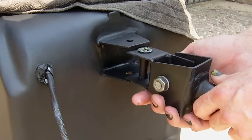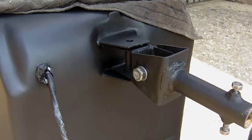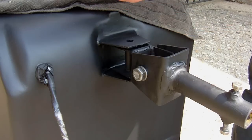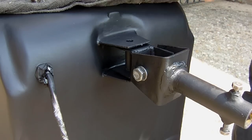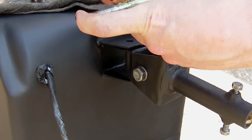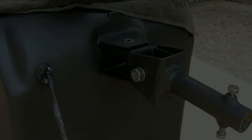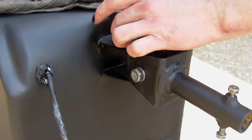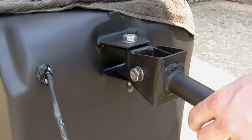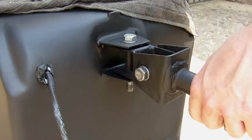Now here we go, I'm going to proffer that up — here we go, it slides in — and then we'll pop the bolt through. Now this one's a longer bolt that I've used, so this one's a lot longer, so what I'll do is I'll put a lock nut and some Loctite on it, and that should do it. So we'll grease up the shaft — we want plenty of grease in there — staying away from the threads. So we've greased up the shaft, put the washer on, plenty of grease, mind the threads. What I'll do is clean up the threads with a bit of white spirit anyway. That's a lot easier, and that's what you want — nice and loose, but the bolt's tight.